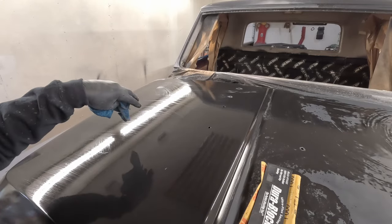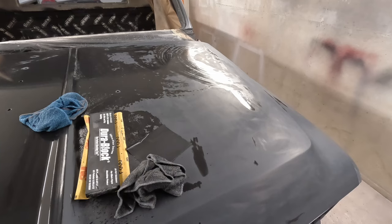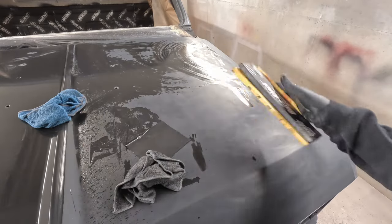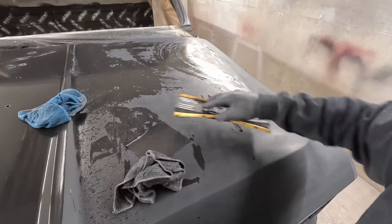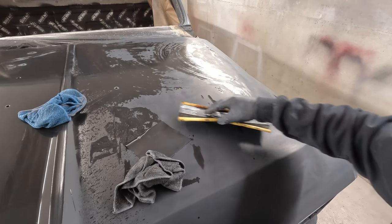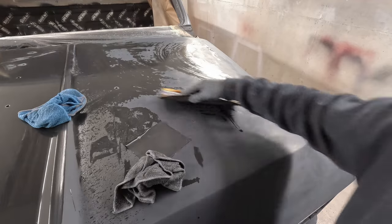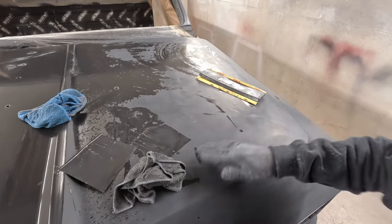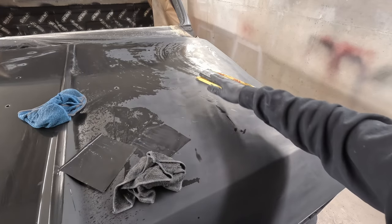Let that dry out. You'll be able to see anything that's left. But look down this one here, where I haven't wiped it yet. You can see, you've got to avoid getting too much of this. That's why you keep going in an oblong circle, because you don't want to stop and start, stop and start, because you'll have these in it and they'll be deep. As long as you're going in an oblong circle, there's not enough where you're going sideways like this. That'll leave a groove, because you will leave a groove if you go up and stop and up and stop with that edge. I'm going to keep it moving. That's why I go over it again with this, because this will wipe off any of those that are showing on this right now. So I look at that one, it should be a beautiful, nice sanded finish.